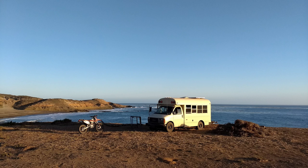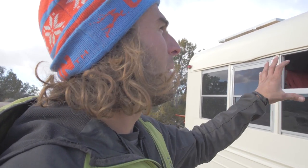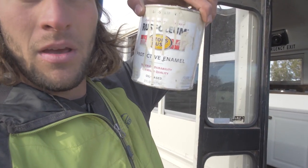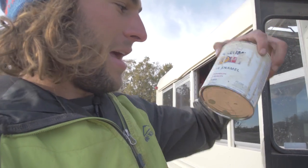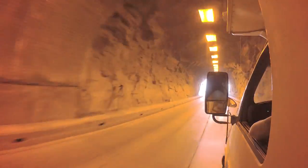One main thing I'd recommend is when you're rolling paint on, roll really light coats and do it slowly, because if you do it too thick and too quickly it'll create bubbles. I used Rust-Oleum protective enamel, oil-based, cut down with acetone a little bit to thin it out. It looks a hundred times better and I was able to get into Mexico. Also I registered it as an RV because I was getting harassed at the border since it was just registered as a bus — they thought it was a commercial vehicle.